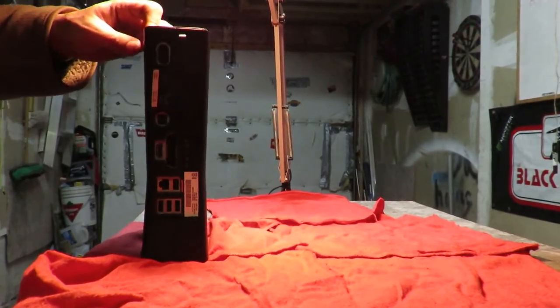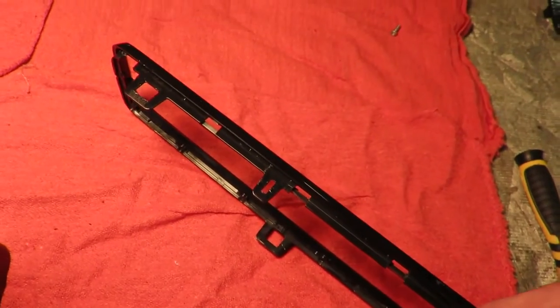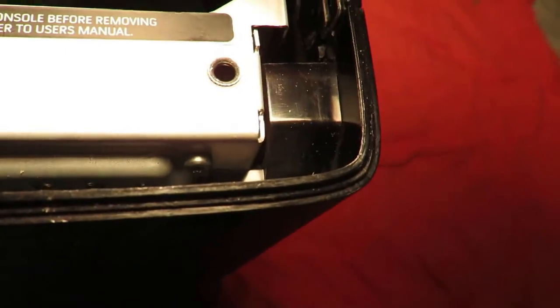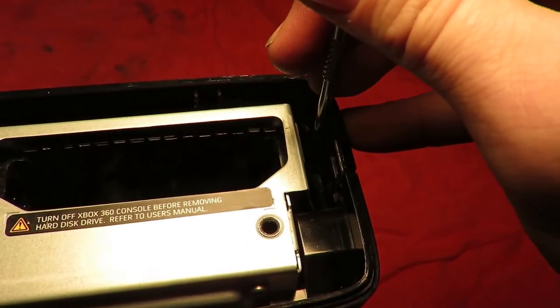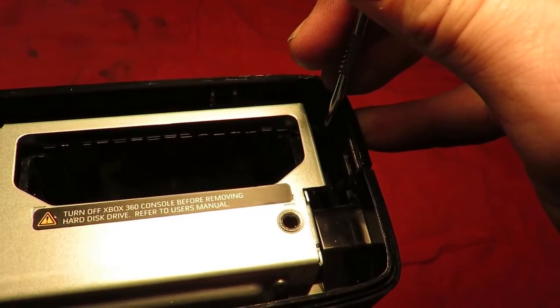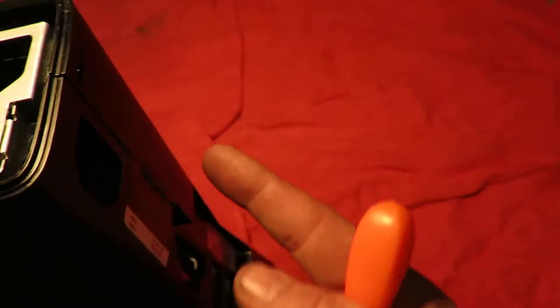It's a little tricky. On the side of the hard drive, there is a tab, just like the ones you took off. So there's six corresponding tabs, and just like how that one comes off, this one comes off as well. You gotta pull it apart. I'm going to need two hands for this, but you apply the tab up and away from where it was resting, and you pry this apart a little bit and then work your way down the back.